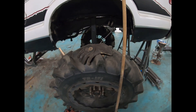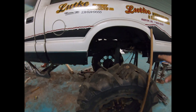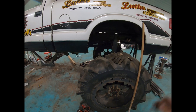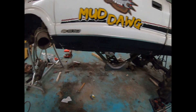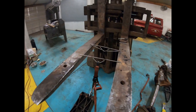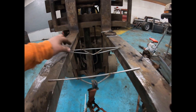These frames from the factory with the leaf spring are mounted in two positions, so that disperses the weight in two spots. Now you have a singular spot, which means that is twice the weight in a singular spot — twice as much leverage. I've made this little model here to show how I would normally do a subframe versus how many people leave a subframe.